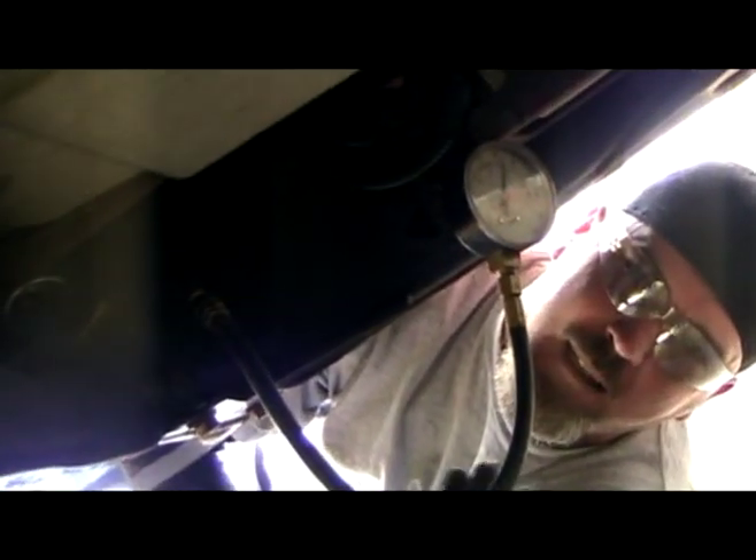There's a black cap on here — you just twist it off, and you can see the little test port right there. I'm going to take the end of my fuel pressure test tool — might get a little stuff and some residuals coming out of it. Plug my gauge up, see how it starts. We're at right about 54 PSI with the engine running.